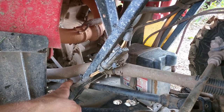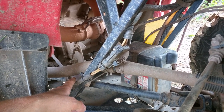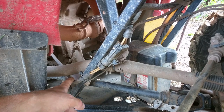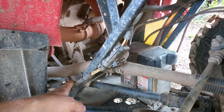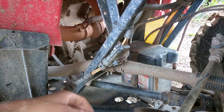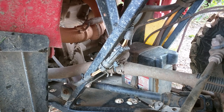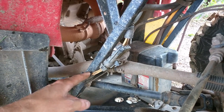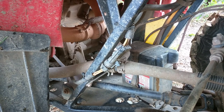Mine did start to chafe down here where it was attached behind the oil filter. The problem is you can't see it, so you don't know it's chafing until it's too late. Because a lot of people had this issue online, I removed mine and relocated it to this position — so far so good, it's not rubbing anywhere and I can inspect it. This is where a lot of people are having issues with the stator wires on the 570s.